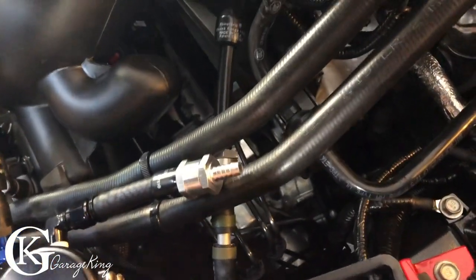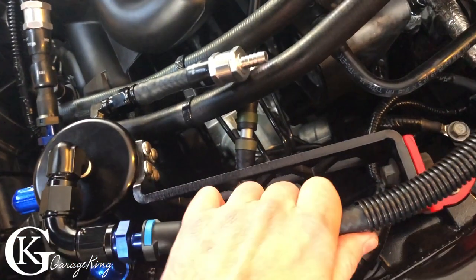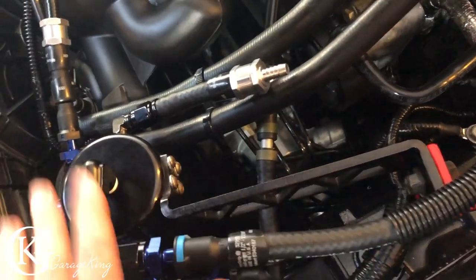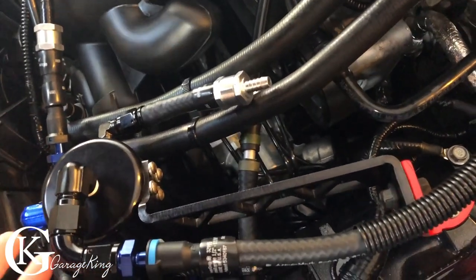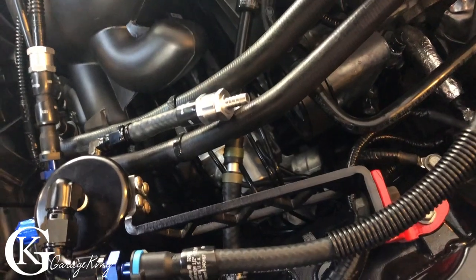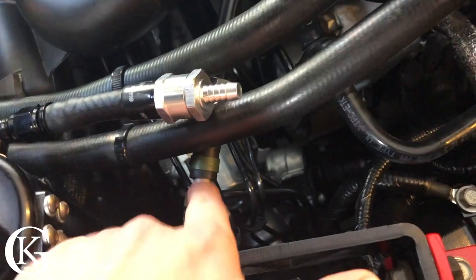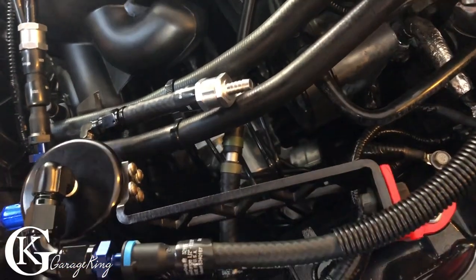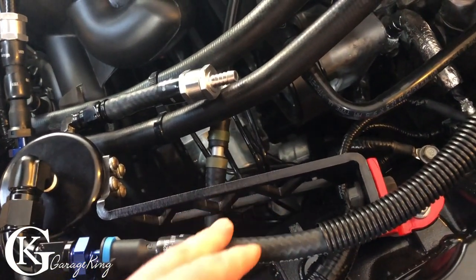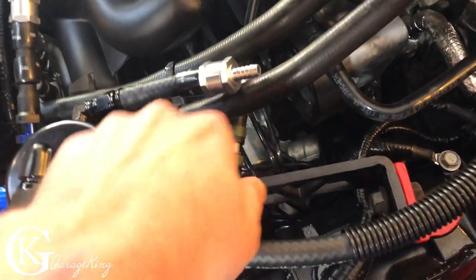That's what it is. So we're basically relying on the throttle body and the air velocity here to provide us with that vacuum. Now there are cases where I believe this engine may need more than 4 cubic feet per minute. It just may need it, but only briefly, like maybe at wide open throttle, you know, bursts, stuff like that. So by me placing the restrictor right here, now what I've done is there is no restriction on this hose. It can flow as much as a 3/8 ID hose will let it flow, which is way more than the factory ever needed. So that's why we have our restrictor here.